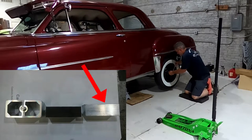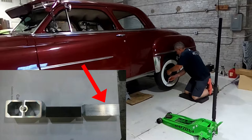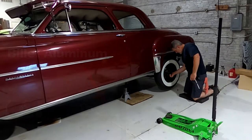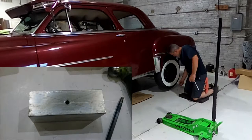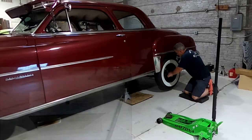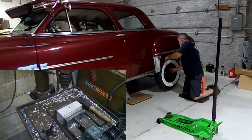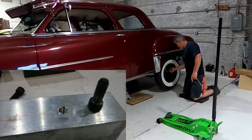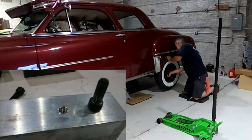I decided to change gears and went to the metal supply and got inch-and-three-quarter wide — the proper width for the springs — and could only get it in two-and-a-half-inch tall, which for what I want is fine. I found the center of the aluminum block by crisscrossing to the midpoint and drilled it out — the final hole was 3/8 inch — so I could tap it for the cap screw that would become the pin. Here's the rough assembled block with the cap screw as the pin.